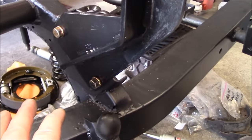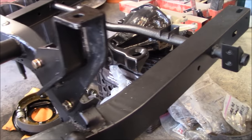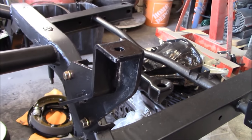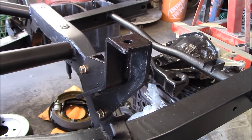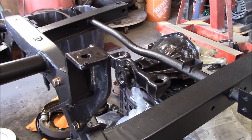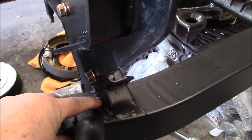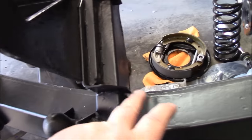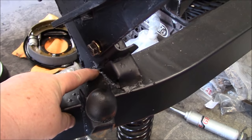We've got the brackets now installed for the tube shock conversion. I said I'd have a discussion about why I'm deciding to go with tube shocks. I ran tube shocks on my TR6 for about six or seven years before I had issues with frame damage. This is a huge topic on the discussion forums regarding TR6s and the tube shock conversion. There are a few different types on the market. This type in particular has been known to break the frame — I experienced that. I've seen cracks in the mounting area and also down here where the differential carrier attaches to the frame. Mine actually broke down there on a road trip — I think I was in Ohio when I heard a metallic squeaking noise, which was the diff bridge moving up and down against the frame.